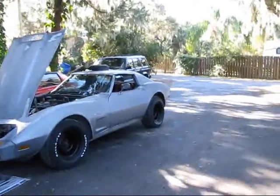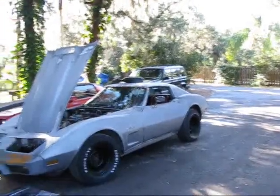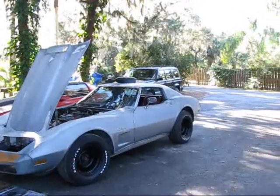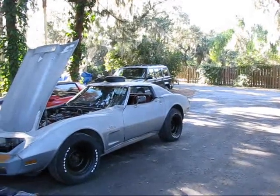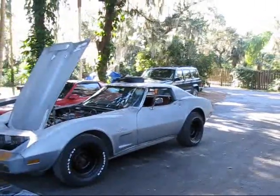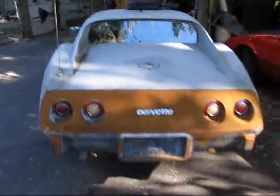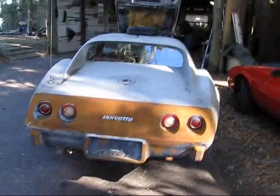You may notice a little difference in the exhaust — that's because I got rid of the catalytic converter. I was pretty sure it was stopped up, and I had already cut it in front like I mentioned in the last video. I stuck a piece of flex pipe in there temporarily just to seal up the major exhaust leak. When I did that, I found out the Y-pipe in the rear of the Vette had a big split where the two pipes connect, so it's really leaking bad there. I'm going to try to get it welded until I can buy a new Y-pipe.